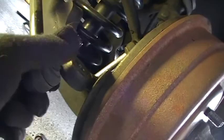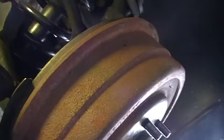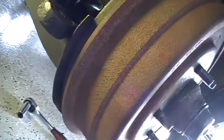I've taken the tie rod end off. See that right there? Take the cotter pin out of this. Undo the nut, take a hammer. Give a couple wraps to that boss right here, and this will fall right out the bottom. Now, I'm going to get back here, and I've loosened the sway bar. This is the sway bar right here, linkage. I'm going to take it out.